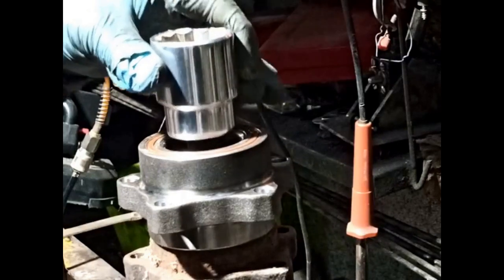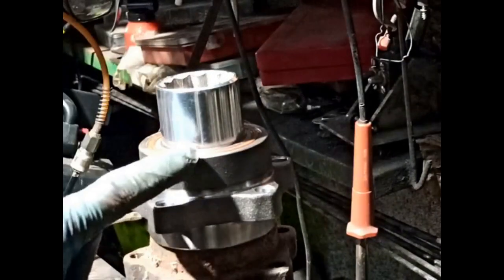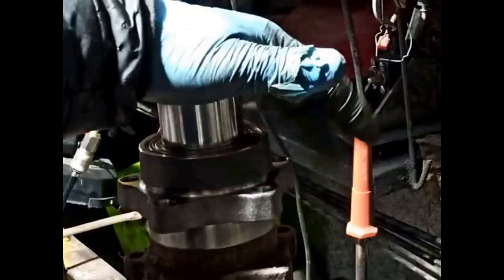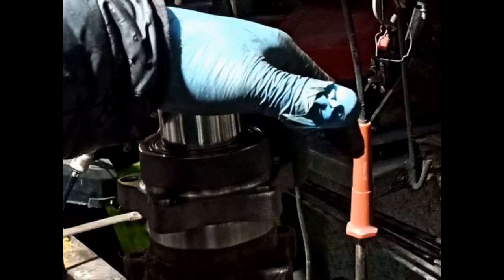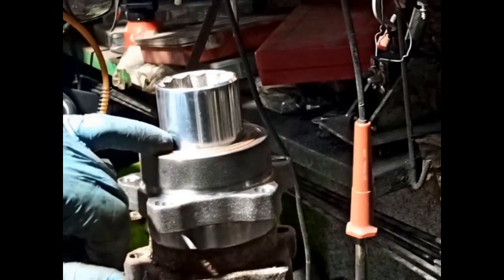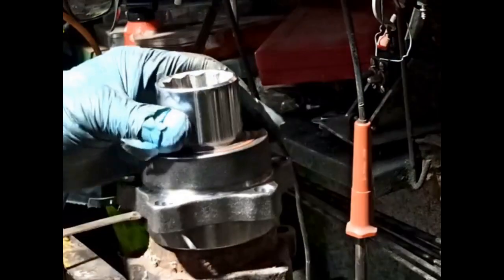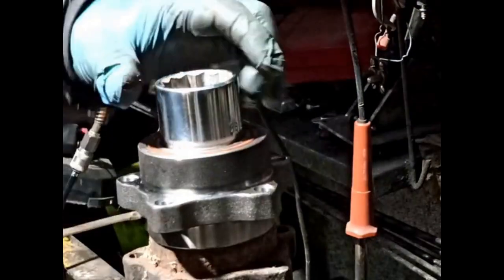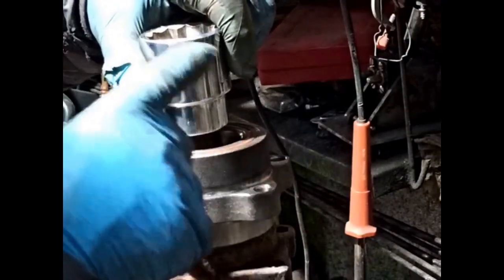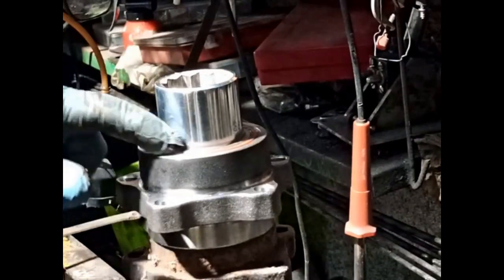Is that we could just push the load down on here. Now that's probably, I don't know whether to do that with the proper setup, with a press or something, but you don't really. What you want to do is be putting the load on the inner race. Now that's not perfect. I've actually got a little bit of space now, so I can't turn that round. I haven't got enough space there to turn that round, because the idea initially was to get this on that bearing surface, that inner race, a bit more.